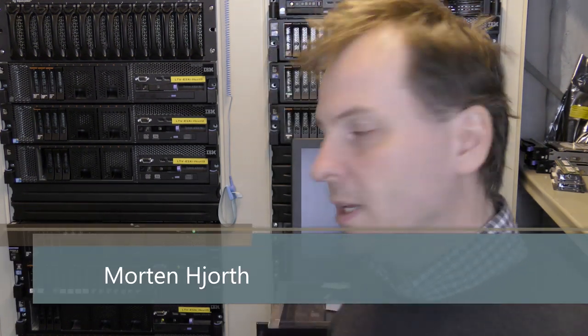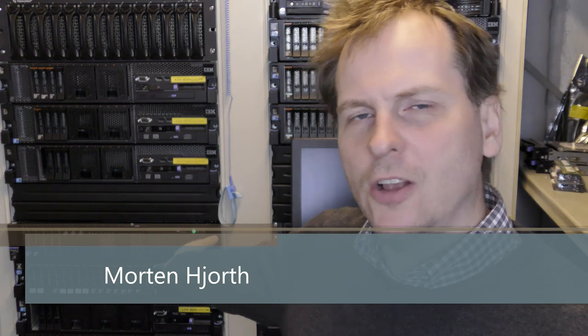And today we're gonna be upgrading this awesome Lenovo X3650 Model 5. This is ongoing. I did a video further back where I put in some hard drives. I put in 3 4-terabyte hard drives and I found that my RAID controller inside of the server was not able to do a RAID 5. Not without me going out and spending money on an FOD, feature on demand key. And I'm cheap, so I didn't do that.